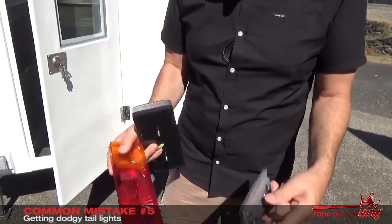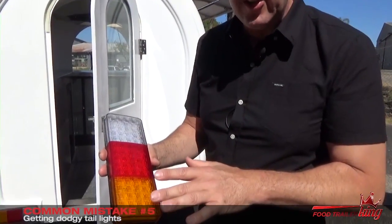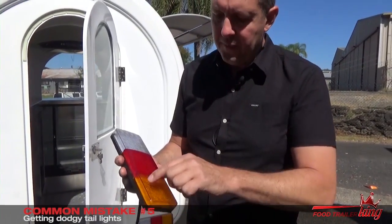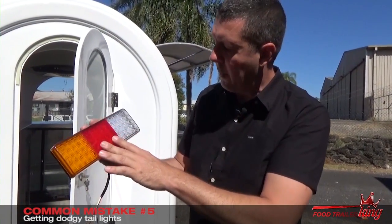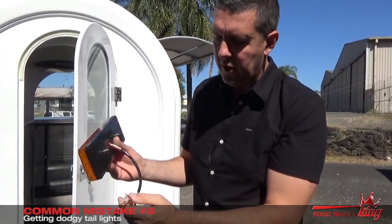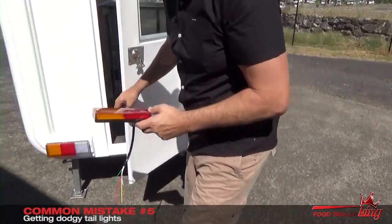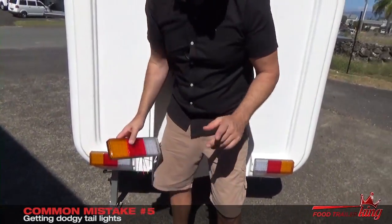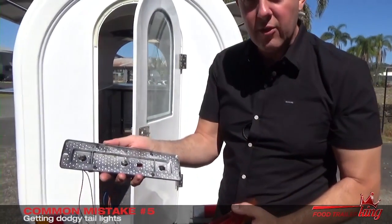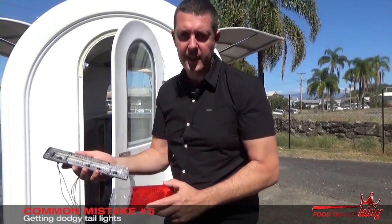The lens is okay. What we do is fit proper good quality LED lights. This is a totally sealed unit. If you know about LEDs, you know that LEDs basically last forever. There are lots of little lights in here — there's probably 12 here, 16 here, and another 12 here, all sitting on a little circuit board. These are completely sealed units, and you can see the wiring is a lot thicker and a lot heavier. We include these on all our trailers. If you invest in a food trailer and this is another common mistake, these standard lights do not last long. We don't want any problems, and we don't want you coming back for any reason whatsoever.